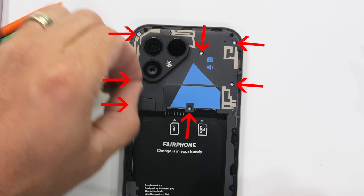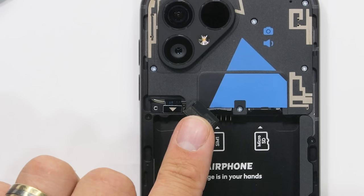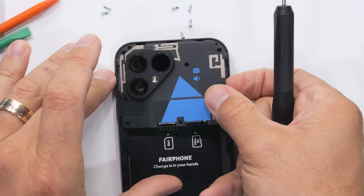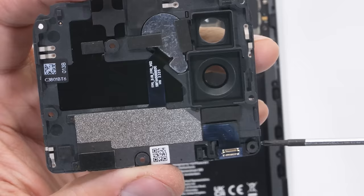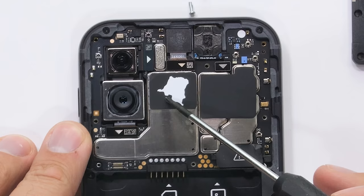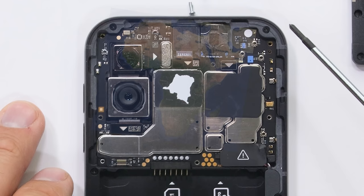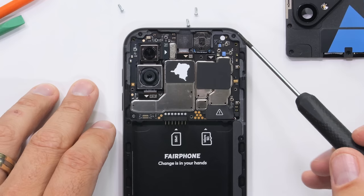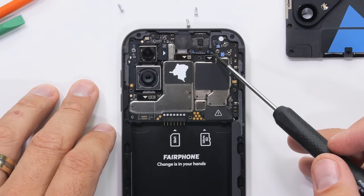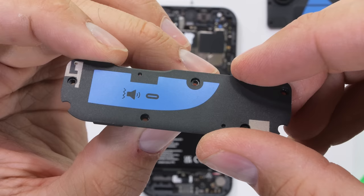To swap any of the rest of the modular components, a screwdriver is required. Luckily, the 7 Phillips screws on the top and the 5 screws on the bottom are all the same size. There's a little bonus flap to preliminarily unplug the single ribbon cable before removing the top plastics. This ribbon controls the flash as well as the time-of-flight sensor next to the two rear camera lenses. You might have noticed a strange shape in the center of the phone — it's actually a map silhouette of the DRC where a lot of mining injustice occurs.